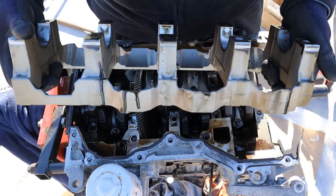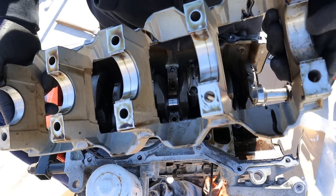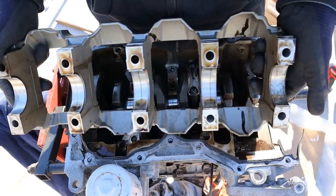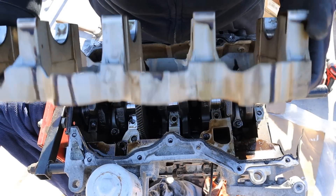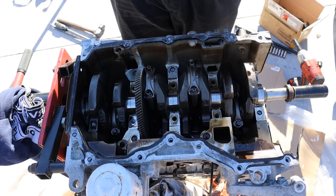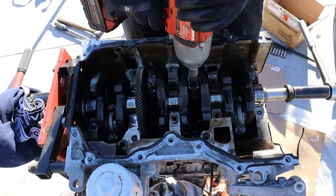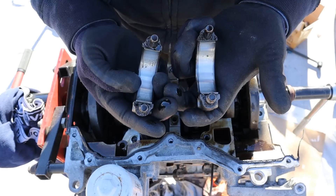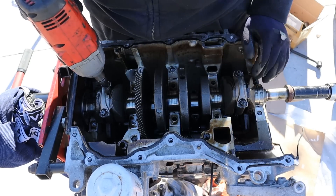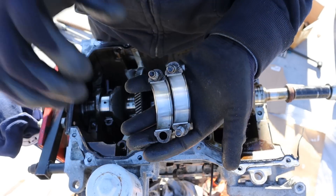The only thing is this ladder frame is made of aluminum — I wish they made it out of steel, but it is pretty lightweight. Looking at the main bearings, they're actually in pretty good condition — not scored up and I don't see any evidence of milky oil. Next up we've got the connecting rods. They're E-Torx 12mm, and the connecting rod bearings are pretty clean. Cylinders 1 and 4 bearing surfaces look perfect as well — no issues there.